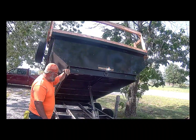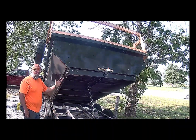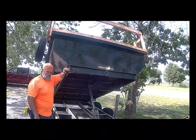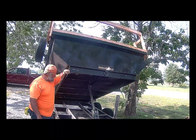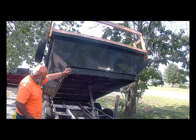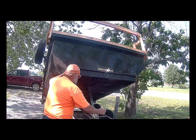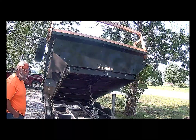The 10 footers, which are two feet shorter in the back, should be four feet. This is 46 inches. On a 12 footer, this should be at least five feet to be 30 percent. And with this trailer, it's 20 percent. I don't know what happened — I think they built it on a 10 foot frame, but in doing so, it is way too short for the length of trailer that it is to stop dumping correctly.